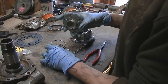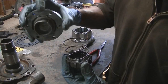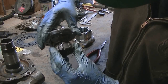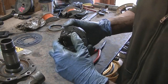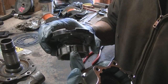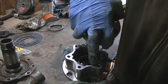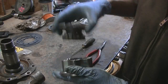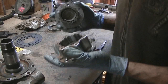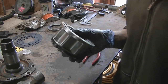Anyways, this part is kind of fun sometimes. These two little lip things that the spring sits underneath and catches on will fit in either side of these grooves. So when you're assembling this, line up the open slots, push it on, and just give it a little twist — that's all there is to hooking that up. When you're putting this back into this, those little lips on that part line up with these two that have the middle piece cut out of them. This is in the lock position right now — and now it's in the freewheel. So again, line those up and your bolt holes should line up. That's all there is to reassembling one of these. I'm gonna take it all apart, grease her up, and then throw her in.